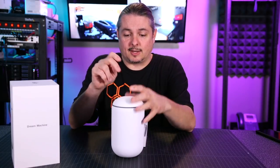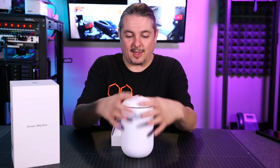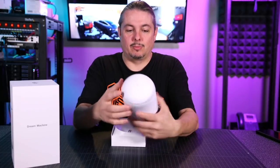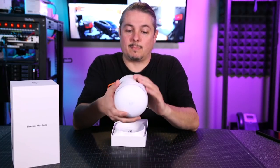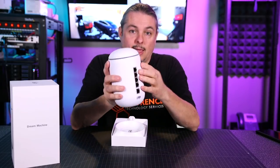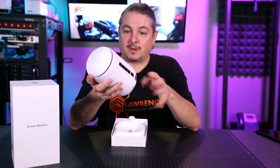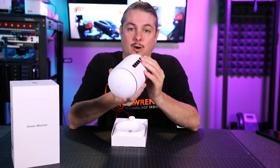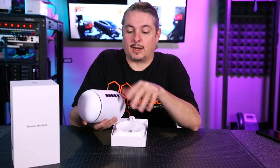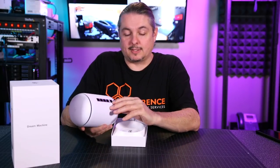This integrates Wi-Fi — I'm guessing at the top — and it does look like a standard UniFi Wi-Fi device. Down below we have the Switch: a standard four-port managed Switch that supports VLANs, and one WAN port. I already looked at the software and it does not appear you can reassign the WAN port to be LAN or WAN 2, so if you had dual connections, it's not really designed for that.